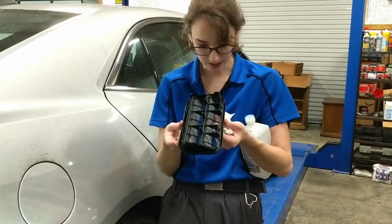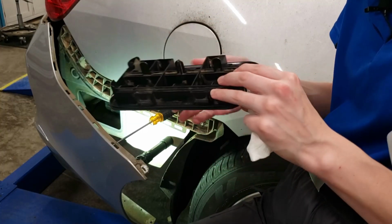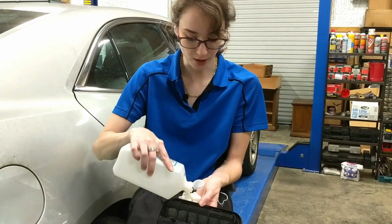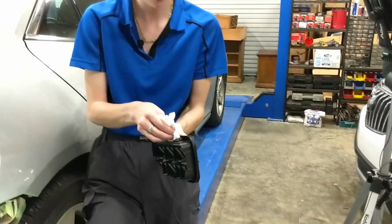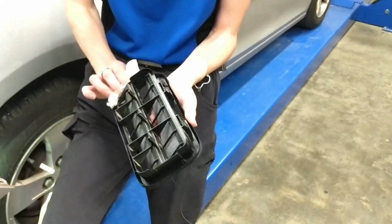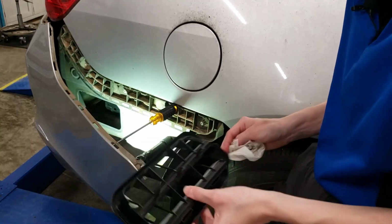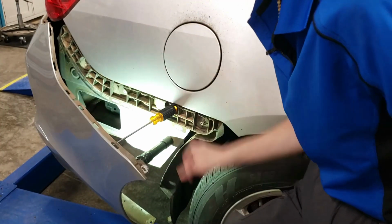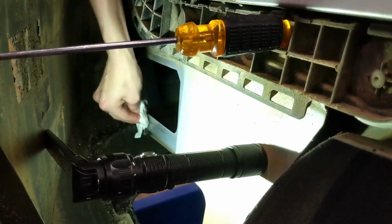And also, my opinion is just that it's kind of warped, this gasket. Either way, it doesn't matter because we're gonna fill this up with silicone so that it won't leak anymore. But now we're just gonna do some rubbing alcohol around where we're going to put the silicone just to make sure we get a good bond. So I'm just gonna rub that around this channel. Now that is nice and clean, we're going to just set this aside and work on the metal panel now. Ooh, this is going to take a little bit of elbow grease.